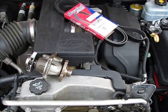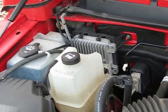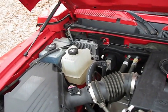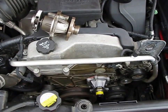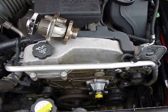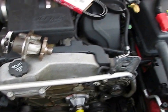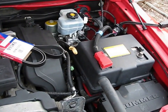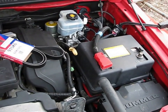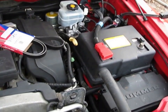In a later video I'm going to talk more about how to EMP-harden it. This is the electronic module back here. There's a device called a transorber — it's basically a zener-type device, specifically an avalanche zener. So if an EMP event hits us, it will automatically snub and ground any high-voltage transients. What's great about vehicles is the wire runs aren't very long, so it's not like a high-voltage transmission line where millions of volts could be induced.